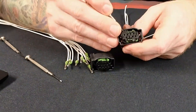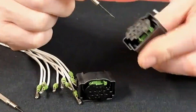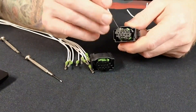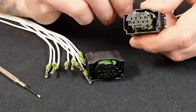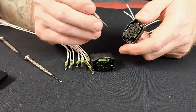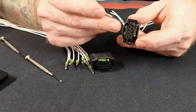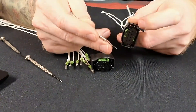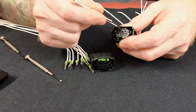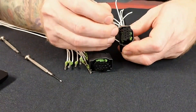You can see right here this secondary lock — it's in green on both sides. If you're looking at one that's on a car or one that came from us, it should already be in the locked position. You're going to have to move each one, and they do move independently and in reverse — so one side moves one way, the other side moves the other way. You've got to push down the little lock and then move it forward.